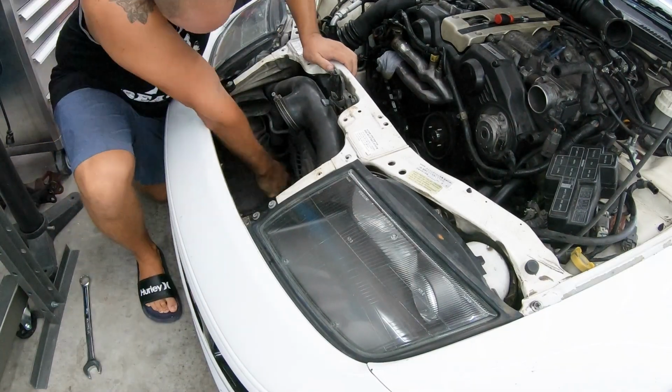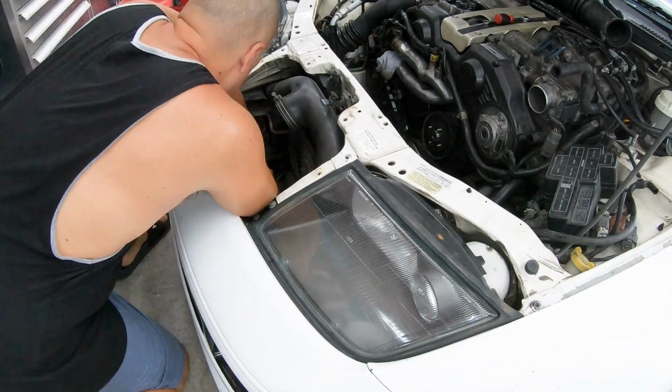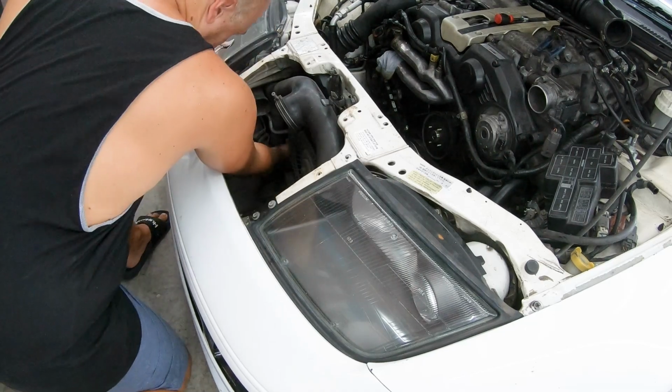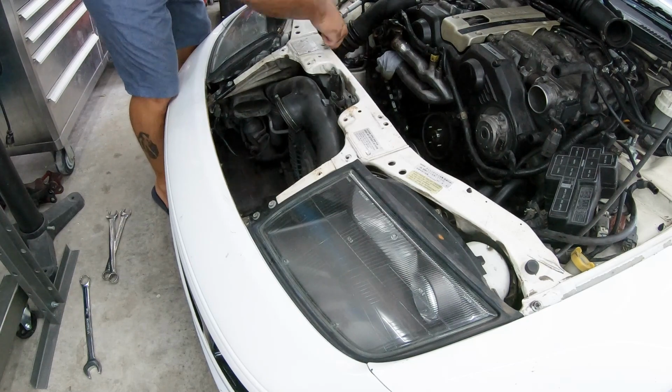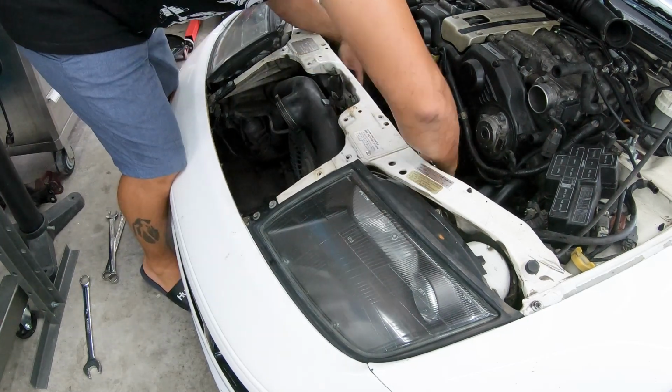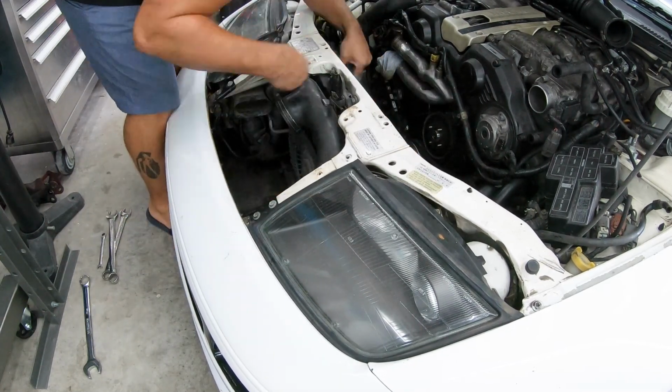Receiver dryer exposed. I'm gonna go ahead and take it apart under the lines to the condenser because we will pull in the condenser as well. So I pulled the radiator out of the way, because of course we have to remove the radiator to get to the condenser, but it opens up the engine bay a ton and lets a lot of work.